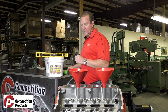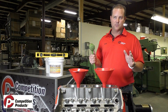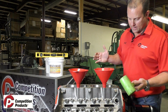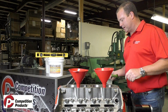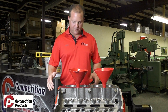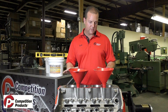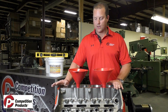Once you get it all mixed, start pouring it in. It's easier with two people — this is kind of a two-person job, though you can do it with one. Once you start pouring, use two funnels to work the product back and forth and get it into the water jacket. Take your light rubber mallet and just lightly tap on the block to help get this stuff to fall into all the little crevices, on both sides of the block. Keep working around once you get it to the level you want, depending on whether you want a half fill or a tall fill — make sure you have that figured out before you start. It's going to take about five to ten minutes, and this stuff will start to solidify. Within an hour it will be initially set up so you can start on the other side.